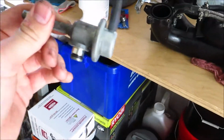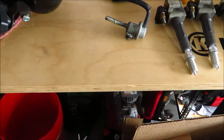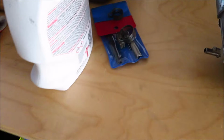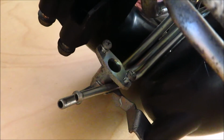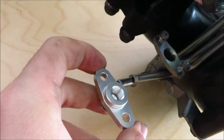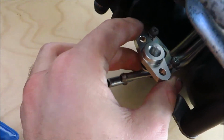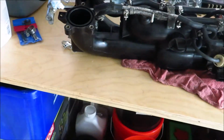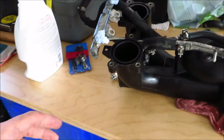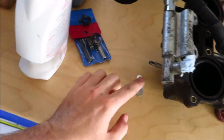Now when you're running higher horsepower and all that stuff, you want to be able to adjust your fuel pressure to suit your injectors and whatever you need. So you can't use that factory fuel pressure regulator, so you need to get an adapter. You can see we have that thing right there, and this goes right in that hole, and then it adapts it to 1/8 inch NPT, which I'm going to get an 1/8 inch NPT to a -6 AN fitting, and then I'll be running lines to an aftermarket adjustable fuel pressure regulator, and then into the factory fuel system into the firewall.